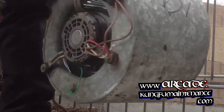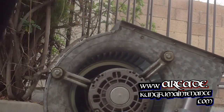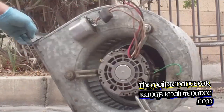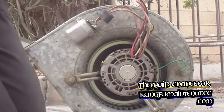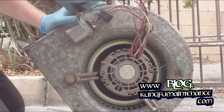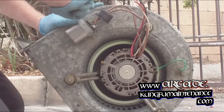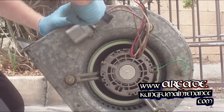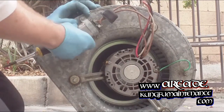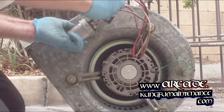We'll deck the whole thing and put it all back in place. One more thing — I'm going to go ahead and replace this capacitor, as that's the only thing that's looking a little tired on here. Of course, I've already discharged the leads. I'm going to go ahead and slip those leads off.